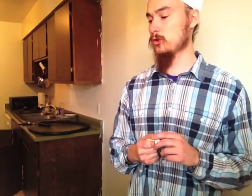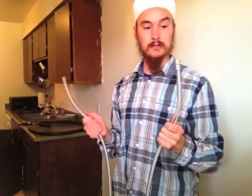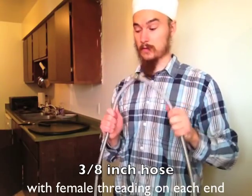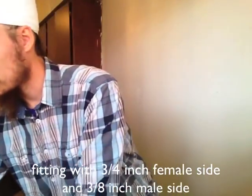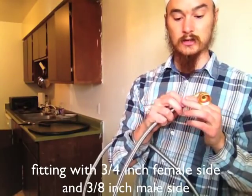What you need to do is find a dishwasher hose rather than a washing machine hose, and then you can connect that up. Since my washing machine will be installed next to the counter and it's a lot further than a normal hose will reach, I grabbed the longest hose they had, which was an 8-foot hose. Here's the 8-foot 3/8 inch inlet hose, and here's your 3/4 inch female hose thread, which attaches nicely to your 3/8 inch hose.